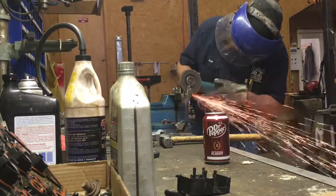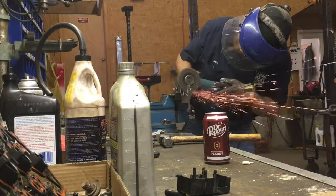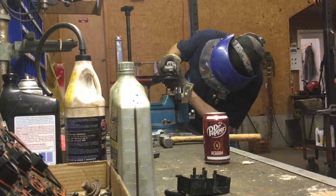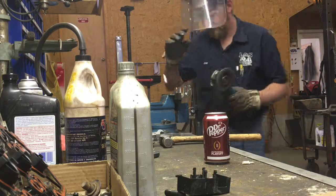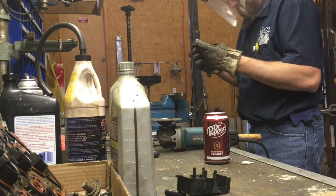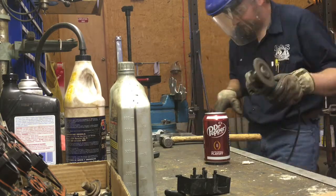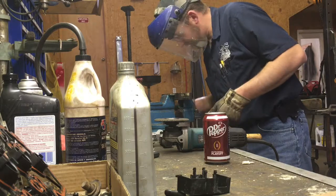Here I'm using an angle grinder with a grinding wheel. I had a wafer wheel — a cutting disc — that I used to get in there and straighten out the lines and actually trim them all the way back, because I just did a rough cut with the torch. I didn't want to get in too close and risk having to recut another one. There was a lot of grinding and going through the cutting disc, just trimming and removing metal. I actually had to use a second full new grinding wheel to get down to the bottom of the areas that go over top of the cams. The slightly worn one wasn't quite big enough, so once I got to that point I put a brand new grinding wheel on just to finish that out and clean it out.